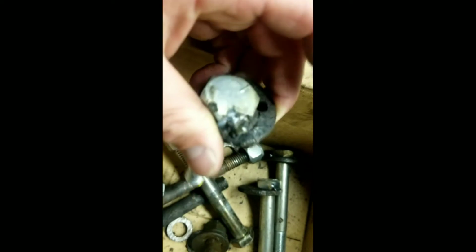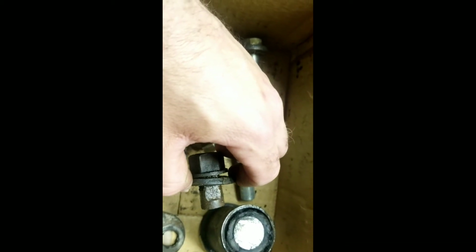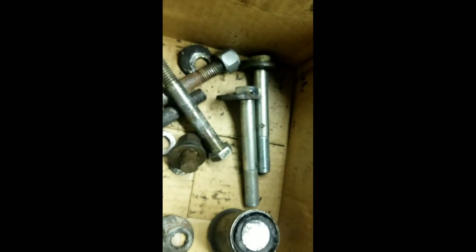So technically, my welded eccentric washers, I could flatten that if I have enough threads sticking out past the shank there, that the flat spot on the adjustment washer will sit. I wouldn't try to chase it on forward, so I don't know if I'm going to do that, but that might be a solution for your thing. Otherwise, you could just drill those out round. But I'm going to go ahead and put these back on the car and see what I can come up with.